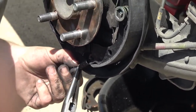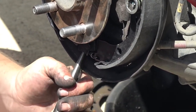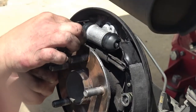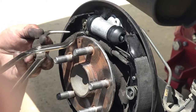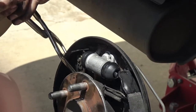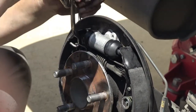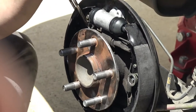One way to minimize any dirt or contamination on the brake linings is by placing masking tape — once you've completed the install at this point, you could begin to remove it because you wouldn't be touching the linings too much at this point. That's installed. The last spring is the tough one. If you have this tool, it does a lot of the work for you; however, there are sometimes where I still have to grab a pair of pliers and guide it in at the same time into the hole. Sometimes it works well, sometimes it doesn't. There are times where I just turn around and grab a pair of diagonal cutters because I'm not able to get a good reach.